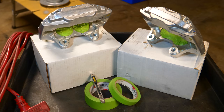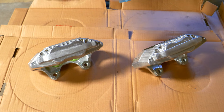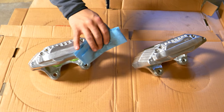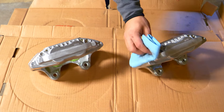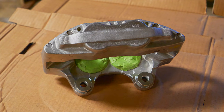With both calipers now masked up and ready to go, we need to clean off the surface of each one so that the paint and primer will adhere nicely. Since our fingers have oils on them, we don't want that oil to interfere with the paint — if we don't clean off the oil, the paint won't stick. I'm going to be using a little bit of brake cleaner along with a shop towel, spraying the brake cleaner on the rag first and then wiping everything down. This should remove all the grease, dirt, and any aluminum dust still on the caliper. Let this sit for a couple seconds so any brake cleaner will evaporate.